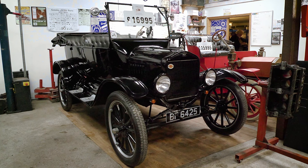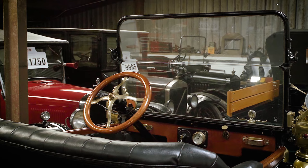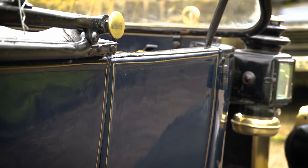Model Ts were made of very high-quality steel. Some of the British-built cars, where they've been in the UK environment all of their lives, may suffer more from corrosion. But generally the cars that come over from the States are in drier environments and last incredibly well. The open cars in particular use a wooden frame that all the metal panels are then nailed onto. If that's been kept in a particularly dry environment, the wooden joints can become loose. It's very hard to ascertain the condition of that because it's all hidden away under panels. But if you open the door and everything feels a bit floppy, that's time to start thinking that there may be some work needed. You can get replacement parts — they are remanufactured in the States. The gauge of the steel isn't quite the same, but to the untrained eye you wouldn't notice the difference.